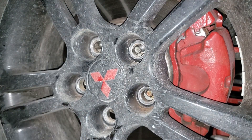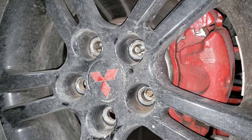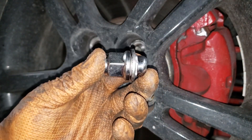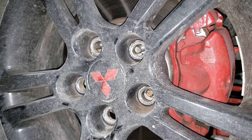Because they used that shitty contraption, it has damaged the wheels slightly. We'll be re-torquing this — I don't think we need to replace the wheels, so we should be okay. Don't put yourself in this situation: if you need lug nuts for whatever reason, spend the extra money and get the dealer lug nut or a suitable aftermarket replacement. Hopefully you heed the warning.